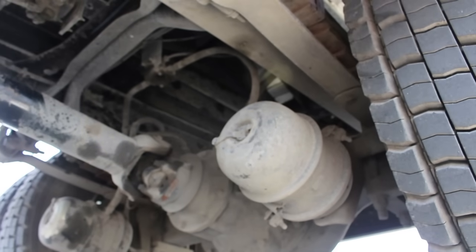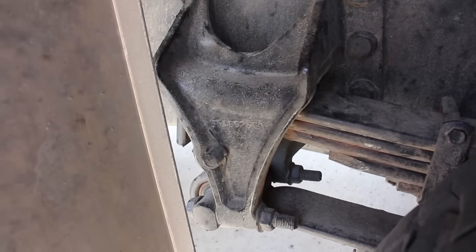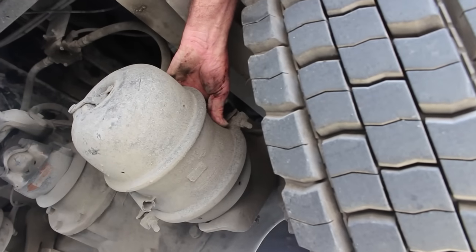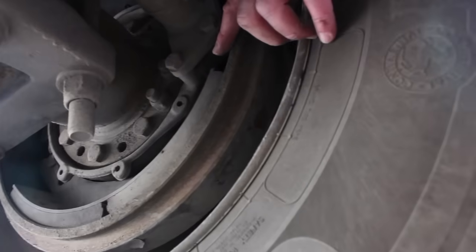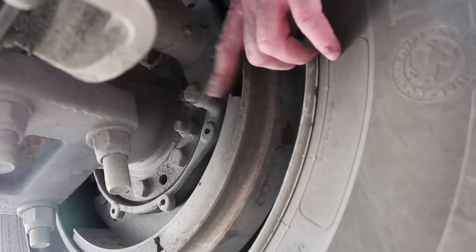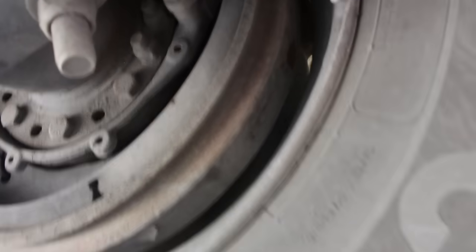Moving to the spring shackle and leaf springs — the spring shackle is securely mounted, not cracked or broken. On the brake chamber there is a push rod and slack adjuster — I would pull on the slack adjuster to confirm less than one inch of travel. Moving inside: my brake shoe is not worn dangerously thin — not less than a quarter of an inch. The brake drum is securely mounted, not cracked, bent, or broken — no signs of bluing, which means heat — and no cracks more than a half inch. The inside of the wheel shows no signs of illegal welds, nothing bent, cracked, or broken.